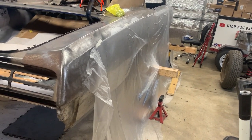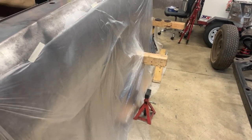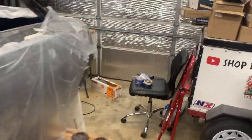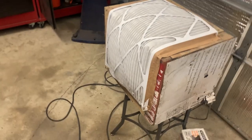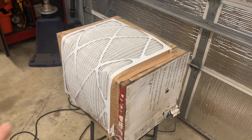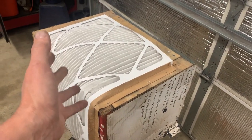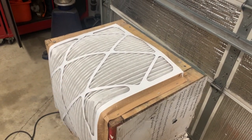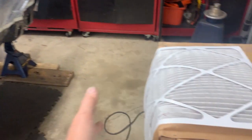I've also put plastic on the outside of the car to minimize overspray and keep it under the car, off the frame and work benches. I'll lift the garage door up, and I've got an HVAC blower motor in a case that circulates a lot of air - it'll pull the overspray into it. I'll also have a small fan at the back of the vehicle gently blowing air forward so it gets drawn into the blower.